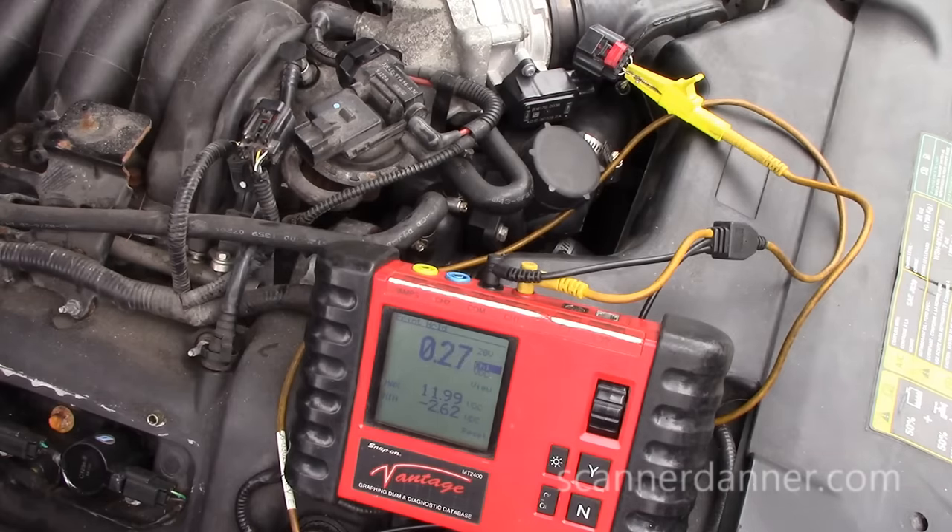The mass airflow sensor on Fords does have a reference as part of it. Let's unplug the MAF — whoa, it jumped up to two volts! But that's still not right — it should go to five. Plug it back in — back to 0.8. What that's suggesting is each sensor has a certain amount of current draw from that regulator. The fact that it jumped up some means you're taking current away from a circuit that's having trouble delivering. I don't think the MAF is the issue.